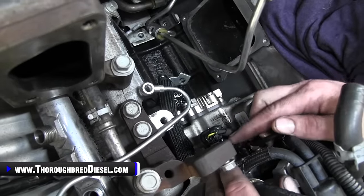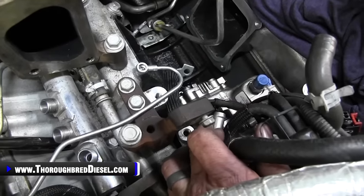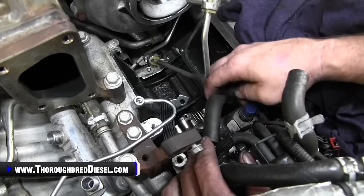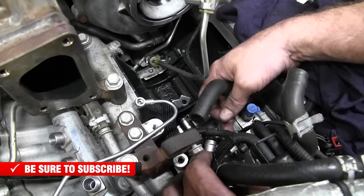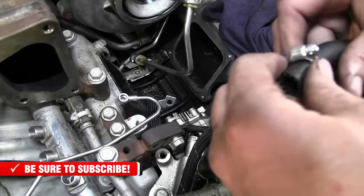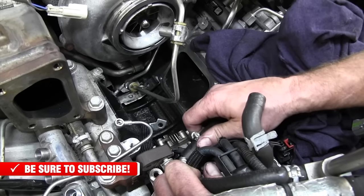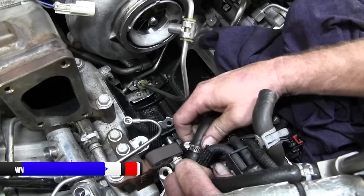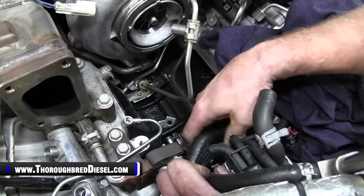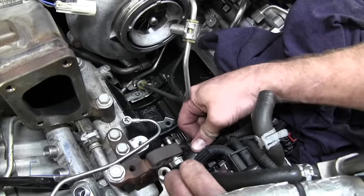Okay, now this fuel feed line, this is the second most important thing here. So your fuel feed, the L portion of it, is going to go on the back of the pump, but the other portion is going to be going to here. So once you put it on the pump, it's there to stay. So you don't want to do that. You want to do this other side first. So turn your pump, your hose, and your clamp the way you want them. Keep this line loose, just like we talked about here. You're going to want to go ahead and put your line on. Real carefully, kind of sneak your clamp past there, and there you go. Now you don't want to be pinching that hose or anything like that when you set that back down in there.